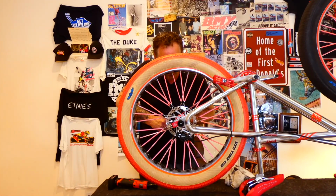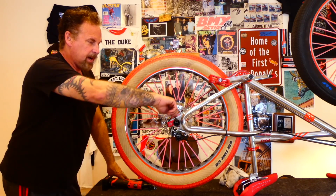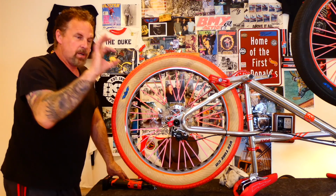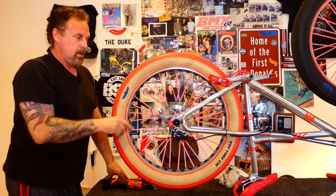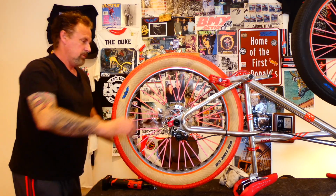Man, what I think would be really good is if that inside brace that rides up against the dropout was bigger in diameter, tied around the axle but bigger, so that it gave more support to the dropout. Oh, yeah. And it wouldn't want to slide so much.